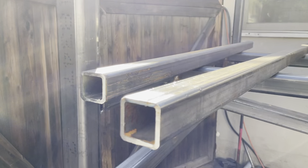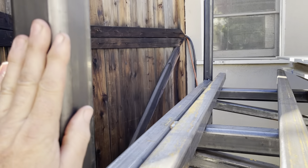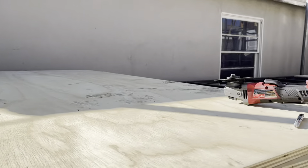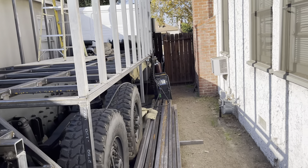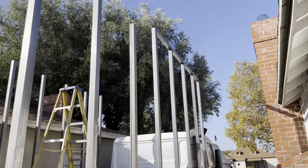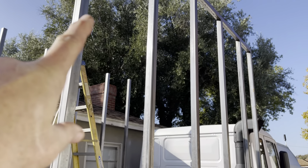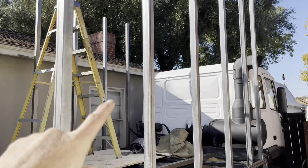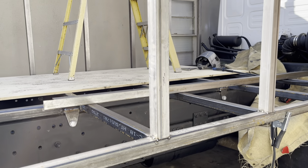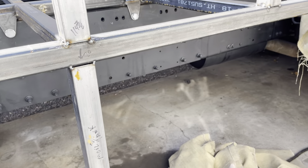This rear section — this was no joke to get in place. We did it with jacks and held it in place. Up there is the tailgate and you can see I'm framed out. Up top, these are one inch shorter than eight-footers, so four-by-eight sheets will come down and end up at mid-rail and attach with VHB — very high bond — 3M tape. Dropped down here will be all storage compartment.